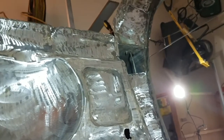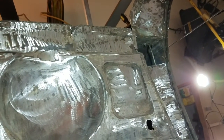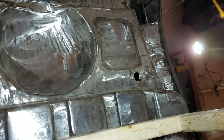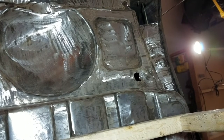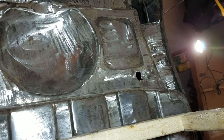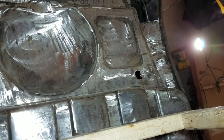I'll do the entire body with epoxy primer in one shot — definitely not anytime soon, probably in a month or two. I've got the inner cowl to do, that floor I put back in — that'll be easy. I've got a few things I want to get done first. My goal was to strip and then start the body work.